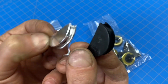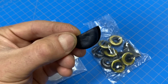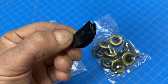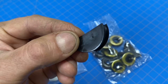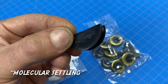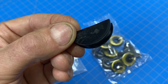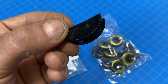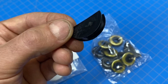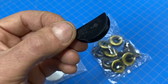These plastic wedges aren't going to expand nearly as much as an aluminum wedge, which is one of the main reasons you develop an oil leak from your valve cover seals. The factory solution is to just add a little bit of RTV on top of these little wedges to help seal them to the valve cover. But over the years I've seen so many people with valve cover leaks. What happens is that over tens of thousands of miles — or even hundreds of thousands of miles — these little plastic wedges actually slowly shrink over time. The best way to describe it is a kind of molecular settling that happens, because every time you heat up this material it allows all the molecules to slightly reconfigure. Over so many heating and cooling cycles, these little wedges slowly deform and actually shrink over time, and eventually they're going to cause a leak, even in a stock non-performance engine.